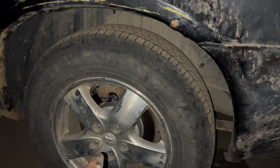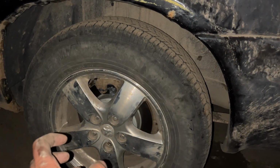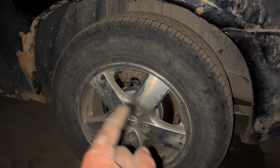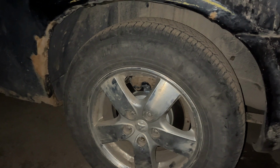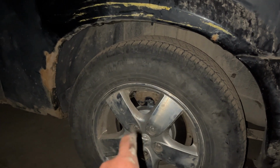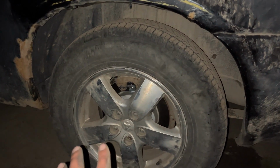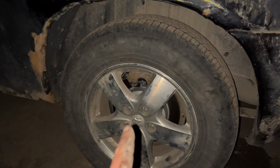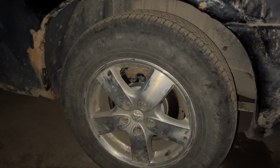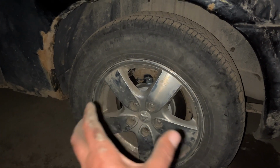And this side was squeak, squeak, squeaking. It's because the e-brake shoes inside were adjusted for the worn drums. I guess the worn rotor drum. And I think they were too far out, and they were rubbing and causing a bit of a squeak. There's also a dust shield on the inside that might have also been rubbing. So I tapped that out quick here in the dark, trying to crank it out as fast as I can. Can't drive it around here right now and check anything because it's too late. So we'll send Carrie down tomorrow to the market. If the squeak comes back, then I don't know what I'm going to do. I might get hammer happy, or I might just leave it until something wears through, because it's just a dust shield that's wearing on the inside.